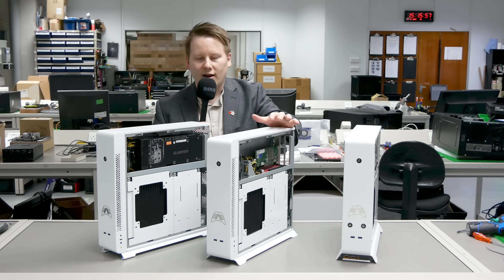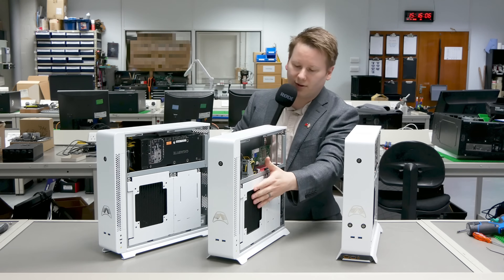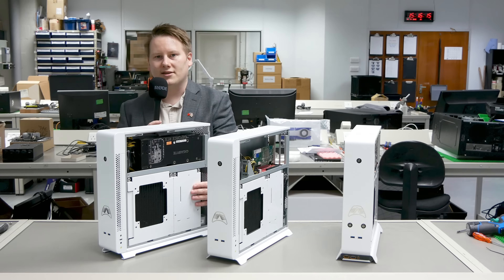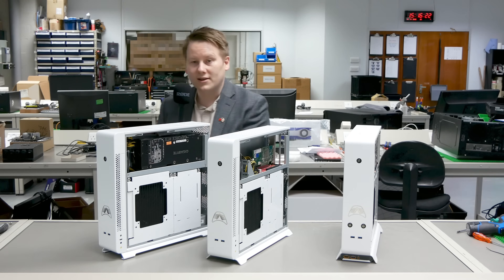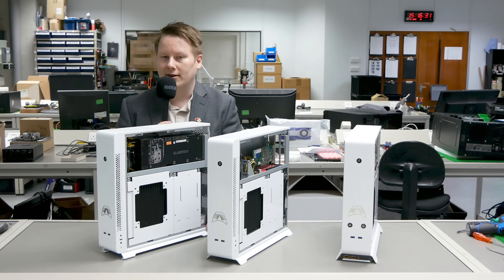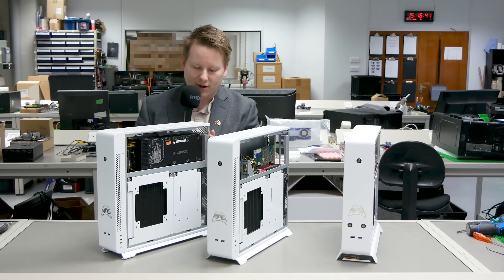These have kind of turned into custom workstation-type duties. These two are 80mm wide and this one is 85mm wide. On here, alongside the liquid cooling, there's a pull-out U.2 slot — that was when it looked like the market was going U.2 for Optane. On the later generations that's turned into M.2 SATA. The newer model has an integrated power supply at the back because customers didn't really need removable power supplies, and also the power supply had to get bigger — going from 750 watts to around 850 watts, because GPUs now consume up to 300 watts and more.